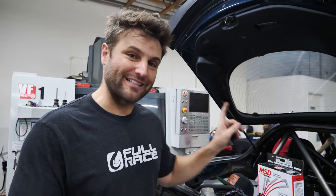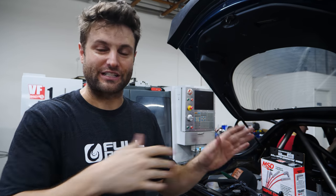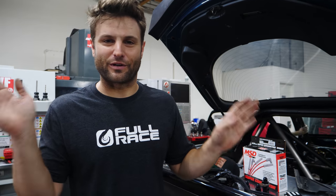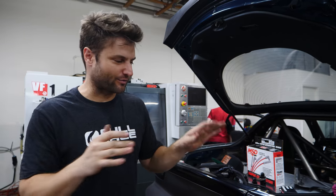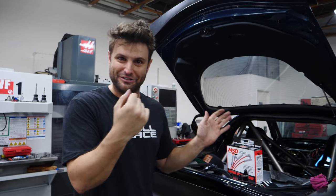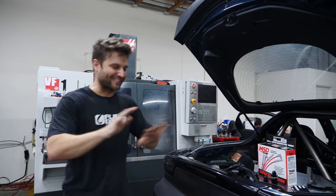Now we've got brake pedal which will have running lights and brake lights, and then we're going to do the same thing with the clutch so the ECU knows when the clutch is in. That way it will enable two-step when the clutch is in because it knows we're talking business — not just revving. We could set up anti-lag to work whenever you rev to 8,000 or 9,000, but when the clutch is in you know you're in gear and ready to go. Of course we also have a gear sensor too, but anyway — finally making this into a car, this is so exciting.